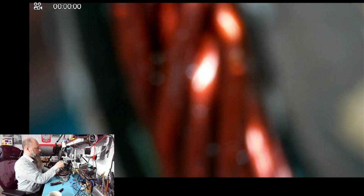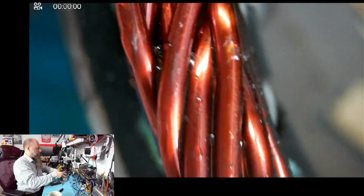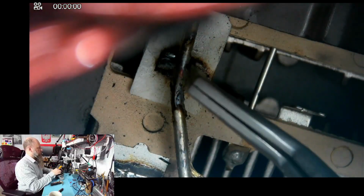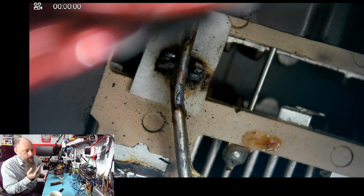So here's my concern, because you might be thinking, well, just solder that damn wire already. What are you waiting for? But my concern is, if I solder this on, right? So I basically fixed this connection over here. Whatever made it hot is gonna still make it hot.